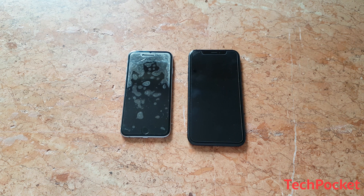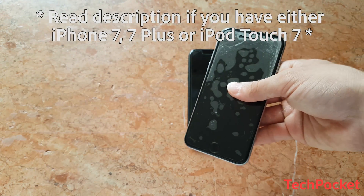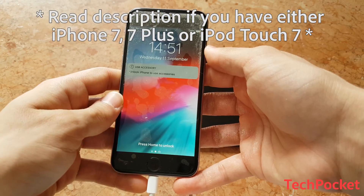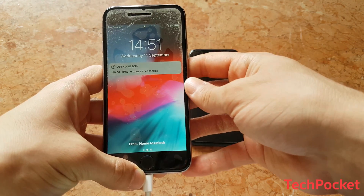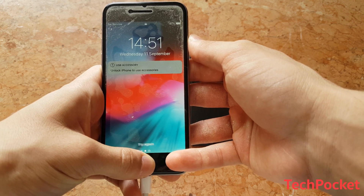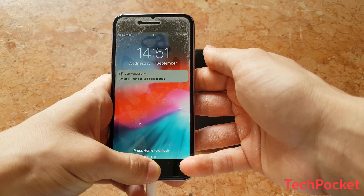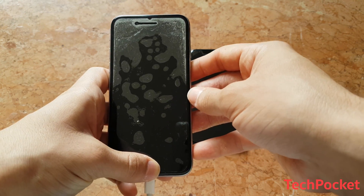Let's start with the iPhone 6 because I'm assuming most of you guys may have an iPhone with a home button. So first of all take your phone with a physical button and connect it to your computer, and then we're gonna go ahead and enter recovery mode. To do this on an iPhone with a physical button — that means iPhone 6, 6S and everything before — you hold down the power button and the home button at the same time for 10 seconds or until you see the Apple logo. Then you release the power button and keep holding the home button for another 7 seconds, or until you see the iTunes logo with a lightning cable pointing to it.